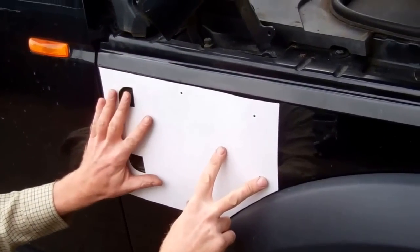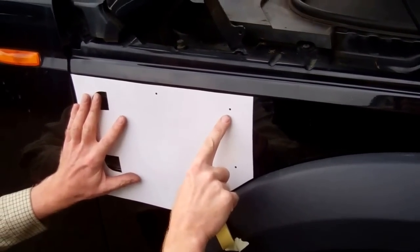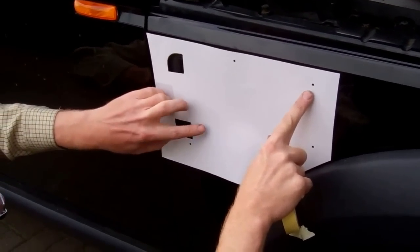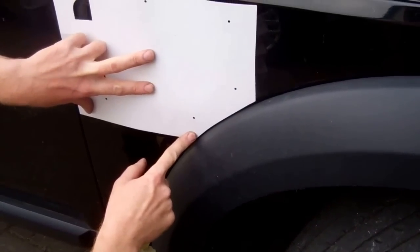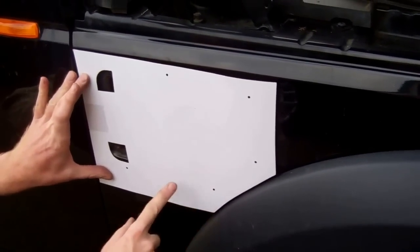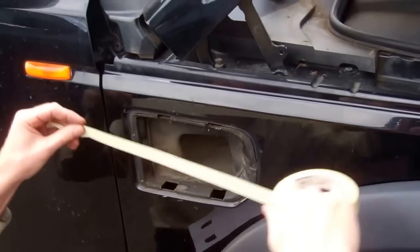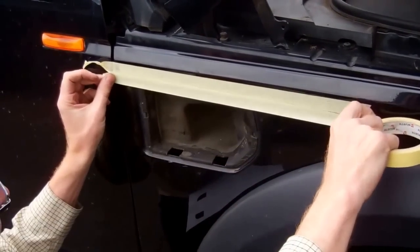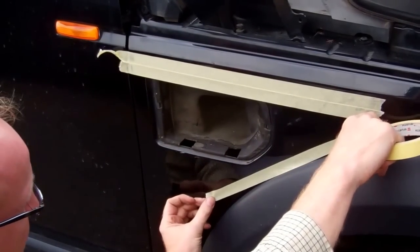This is the template that comes with the kit. You've got this little crease along the top of the wing that you've got to line up. Don't worry too much about the other bits — they don't line up with anything — but this area here should line up with the door. I'm going to look where the holes are going and put some tape in this general area to catch those holes.